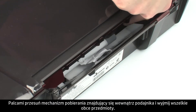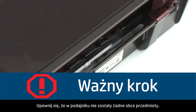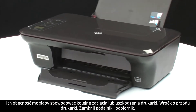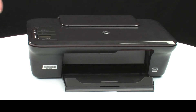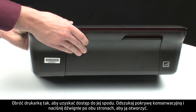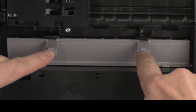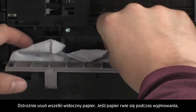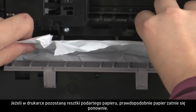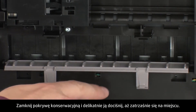Use your fingers to move the pick mechanism located inside the input tray and remove any foreign objects that are found. Ensure that there are no foreign materials that remain inside the input tray, as this could result in further jams or damage the printer. Turn back to the front and close the input and output trays. Turn the printer so that you can access its underside. Locate the clean-out door and press the tabs on either side to open it. Carefully remove any paper you see. If the paper tears while removing it, check inside the door for any torn pieces of paper that might remain inside the printer. If any torn pieces of paper remain inside the printer, more jams are likely to occur.